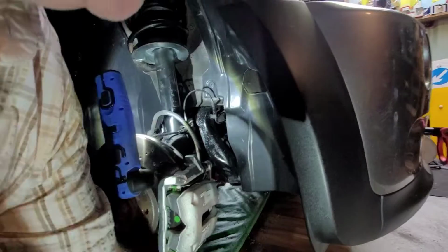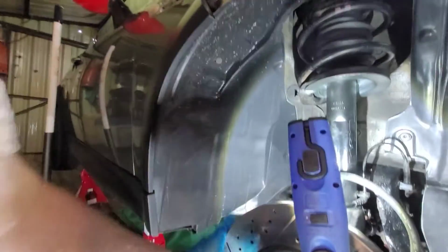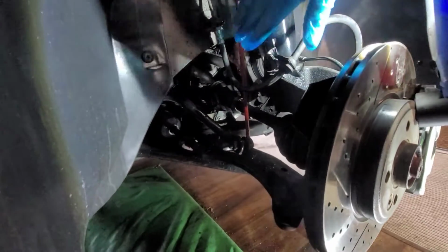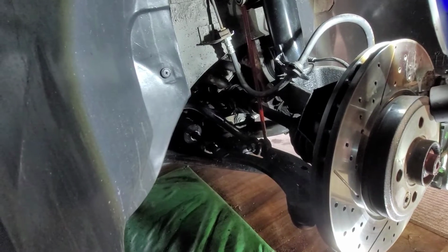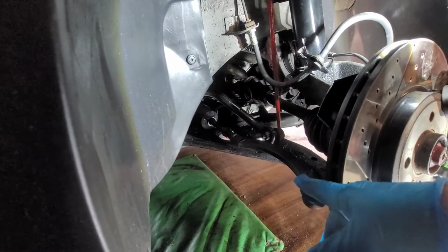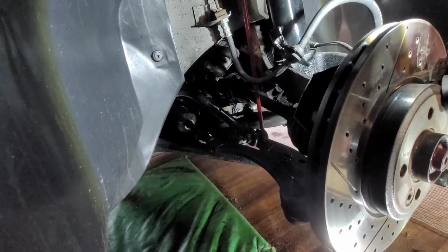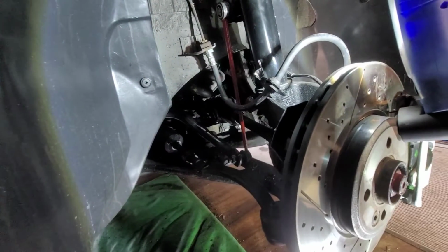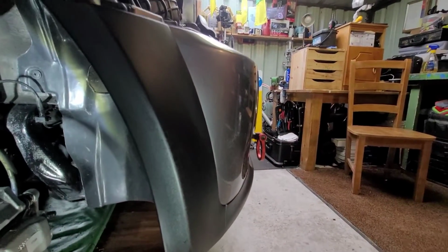It's held on and secured by means of a bottom wishbone, a drop link, which you can see here, and your steering. Now I'm going to try and take off this shock without removing the disc and the bottom or steering, and I'm going to attempt to get it out just by loosening it off the hub carrier and disconnecting the drop link, and hopefully we'll be able to get it out. So, right, without further eloquence, we will attempt this job.